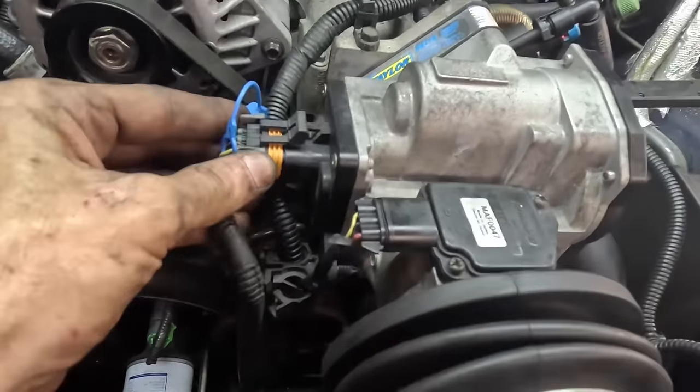We are starting to get some coolant flow here, and there's a lot of oil starting to bubble up. Ten minutes later, let's give the hose a squeeze. It's pretty hot to the touch, and we're getting a lot of oil coming through. Oh, hot. Yeah, the thermostat has opened up, and now we've got some good coolant flow. There's a lot coming through that funnel there. Let's go check the temperature gauge. We're right at 210. This is good. Still got a few bubbles here and there. The oil's getting nasty. Look at that, that's the old coolant. Still some oil coming through right there. Look at all that coming up out of the spout. Bubbling through. Nasty.